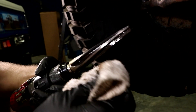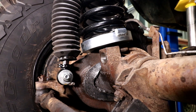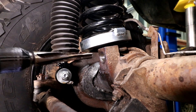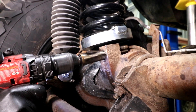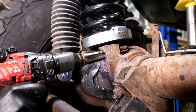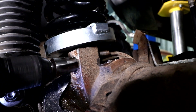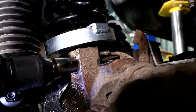I recommend taking a break every couple of minutes and cleaning the drill shavings out of each flute on the reamer with compressed air or a rag. Cleaning and oiling the hole and the reamer every couple of minutes is equally important to drilling straight and not letting the reamer chatter. Full disclosure — we've sped this up to keep the video short, but this is going to take quite a bit of time. It's not easy, and you'll probably want a spare battery charging for your drill. Go slow.